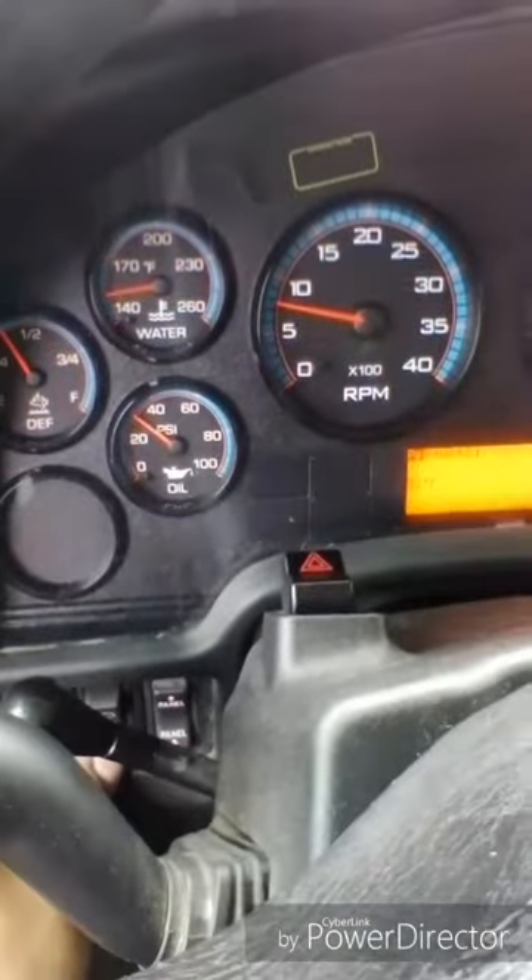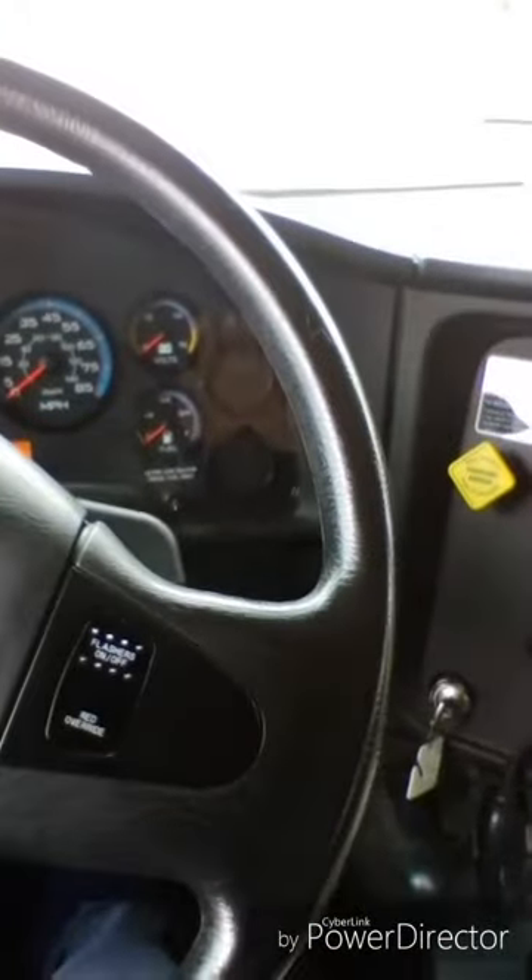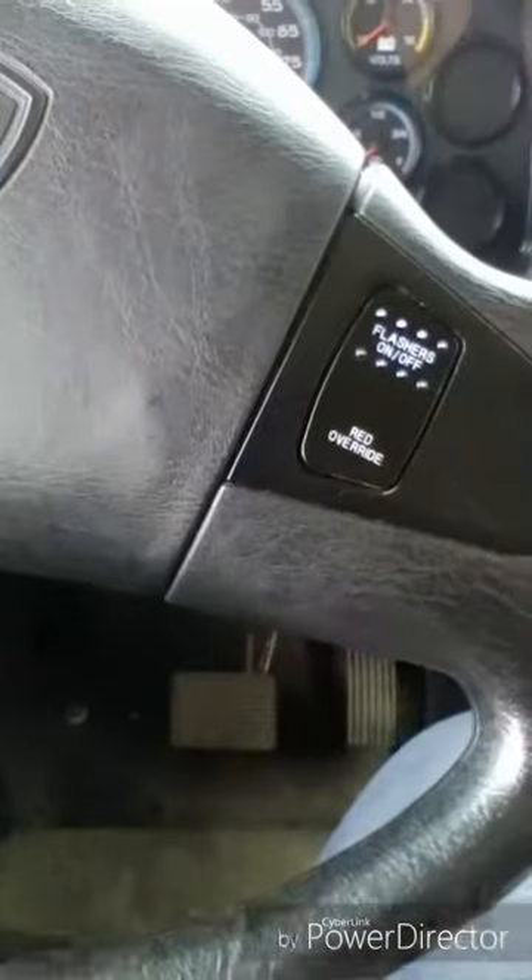I will now turn off my headlights, my master flasher, and my strobe light. I will turn my key back to the accessory position and disarm my student alarm — hold the button down for a few seconds. I will now perform my auxiliary brake test, turning my key to the off position, applying my foot on the brakes, and listening for the system motor. I heard it, so my auxiliary backup system is functional.